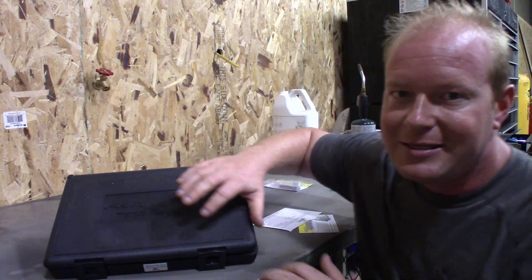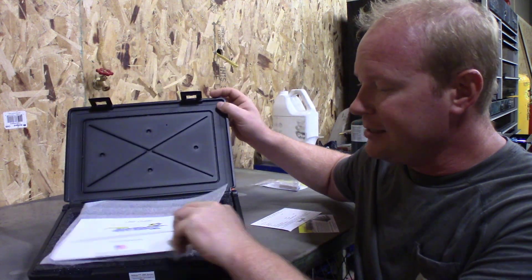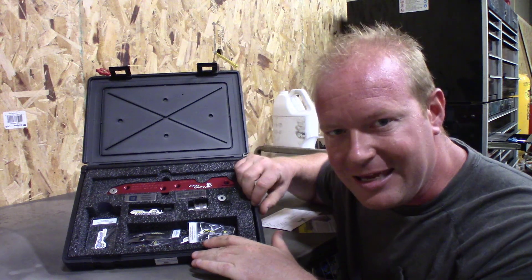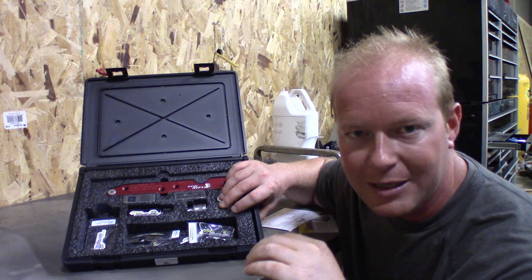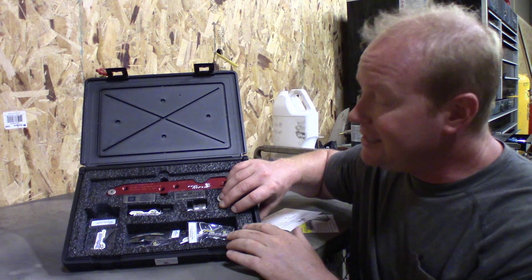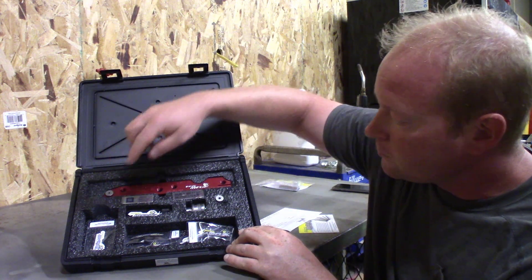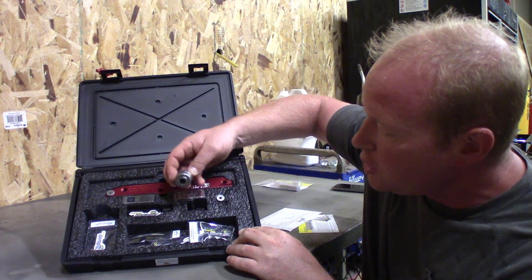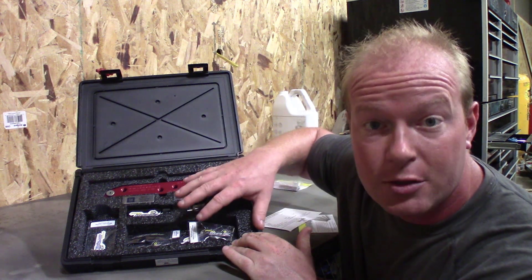They recommended that I get a Mikey 2. The Mikey 2 is an exhaust manifold extraction bolt set — it has everything I need to extract the studs out of the cylinder head without ruining it or trying to tap oversized bolts. It comes with guide precision removal bushings that are replaceable, lube, a drill chuck to fit on a quarter-inch air ratchet, and all the hardware and drill bits needed for extractor-style removal.